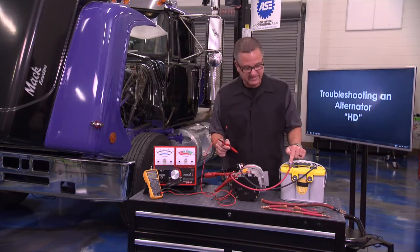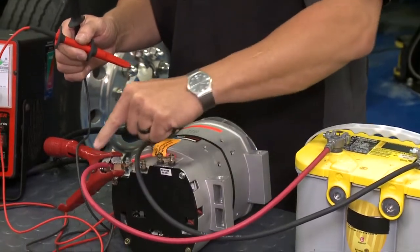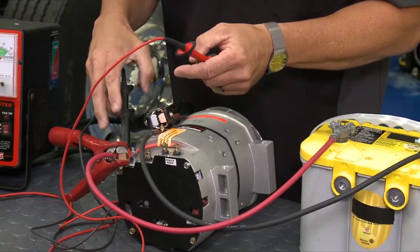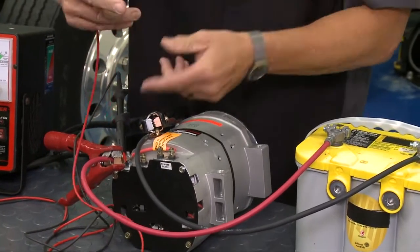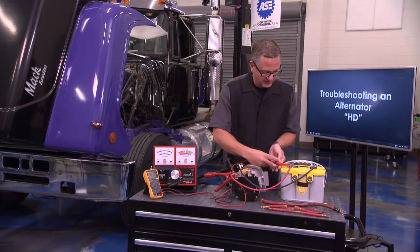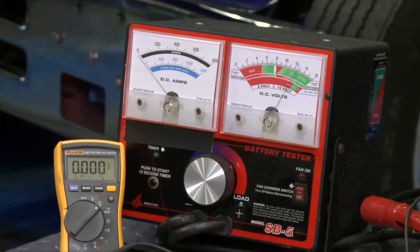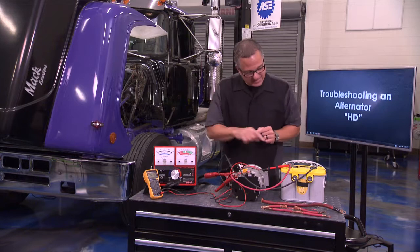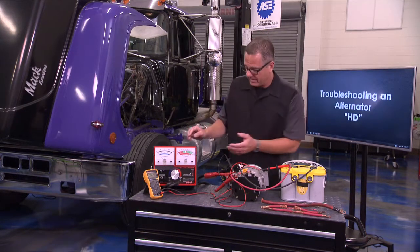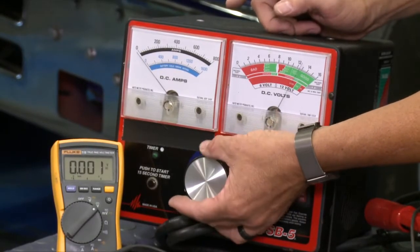Here's the interesting part — to do voltage drops we're going to measure from the actual positive to the positive. When I put some pressure in there and get the amps running through, that's when we measure the drop. I put the positive lead on the positive terminal and go over to the positive on the other side — positive to positive. We're not going to show any voltage right now, and you can see the meter showing zero. When I load it up, the amps will run through and if there's any voltage drop, we'll count it.